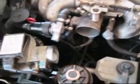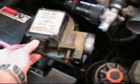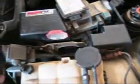Okay, I've gone ahead and removed the flex hose. Next thing you can do would be just to pull out the plug. You mash down on the spring, and this basically just slides right out like that. After that, the next step is you need to pull out the air box. There's a bolt right here, and then there's a bolt right here. If you've ever changed your air filter, you probably already know how to do that. So I'm going to go ahead and loosen those, and then you have to finagle this whole air box out of the engine compartment, and I'll do that next.